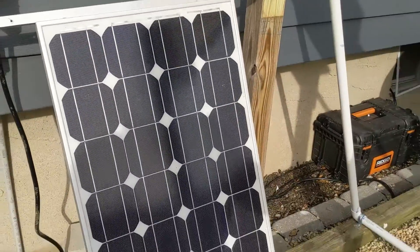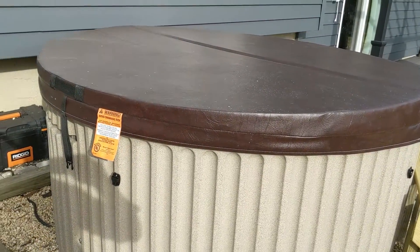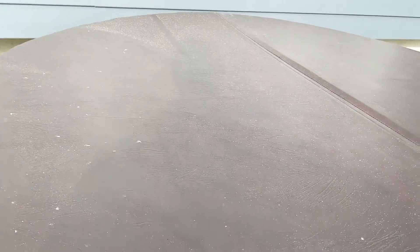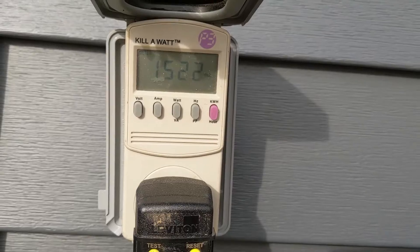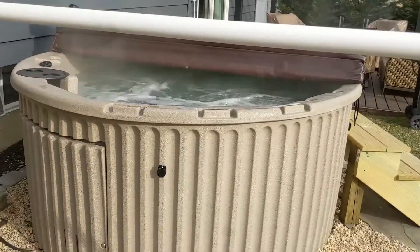This is a test to see how much this consumes in one day so you can figure out your electric bill. Right now I actually have the jets running — that's running at 325 watts. Now I'm going to turn the jets off. With jets on high, I got 1,530 watts — that's what it uses when the jets are on high.